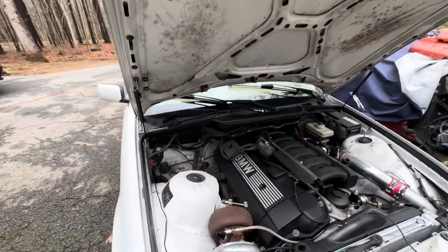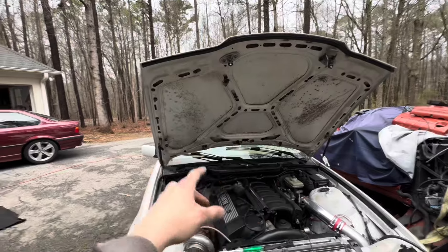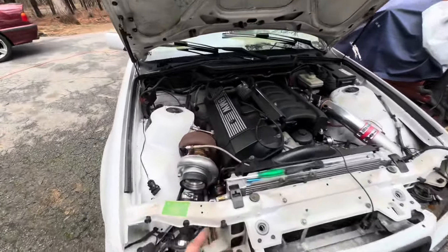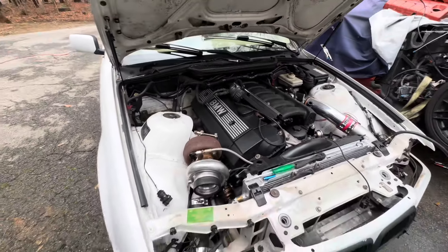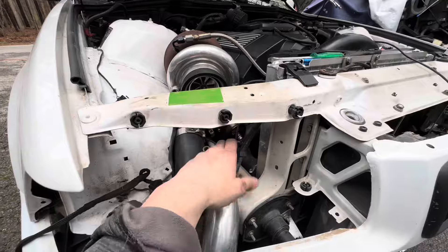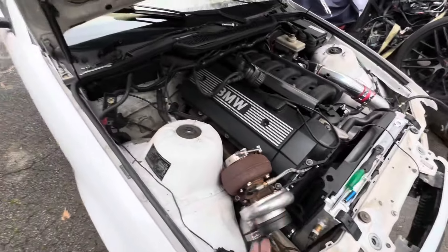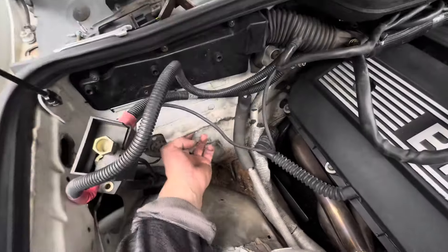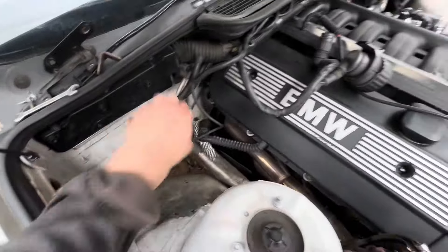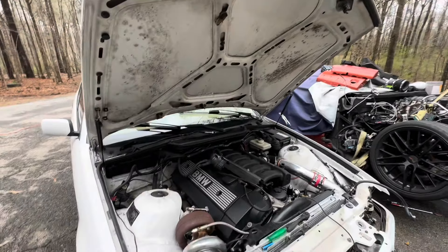Pulled this heat shielding out and took it off the hood as well. It's all mildewy but hopefully it'll look better once I get all the tabs out and pressure wash it. I think I might pull this hot side off - the turbo, wastegate, everything. Kind of want to check all those manifold bolts. I gotta grind all this down and paint it, so there's no point doing it in sections separately - might as well just pull the tools out once and get it all done right. This heat shielding would catch on fire instantly with the heat this thing puts out, so it's all out.